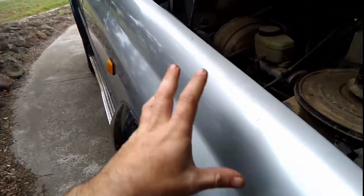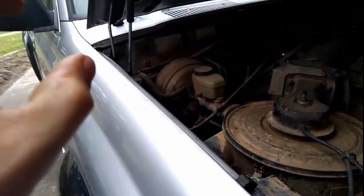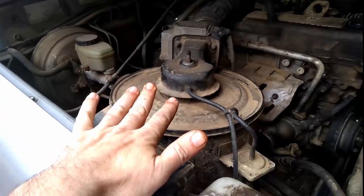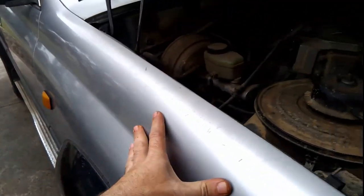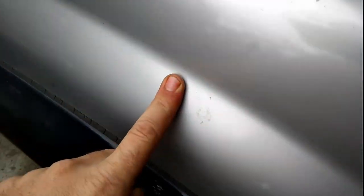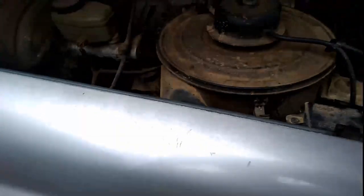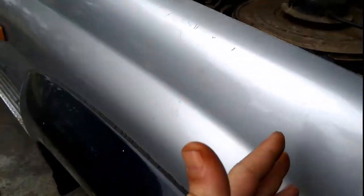The rage now with some people is to put a stainless steel pipe in and have it face backwards, especially with diesel, so you don't get that massive rush of air induction noise coming through your snorkel into your air box. Not so critical with a petrol motor. If I was to get a snorkel, it would be a traditional Safari snorkel — bring it all the way up here, put the hole around the A-pillar area, get rid of the air inductor, and put the snorkel intake piped straight into the air box.